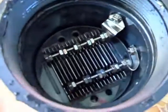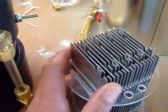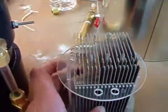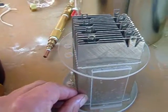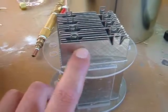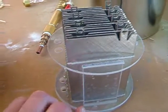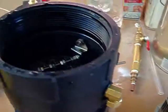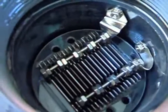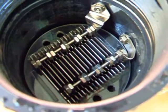This is what's inside. It's a 17-plate configuration with neutrals in between the positive and negative. The plates are treated for high performance — it's a two-step process on 304 stainless steel. You can see in the reflection they've had a treatment done. Complete stainless steel construction means you won't have any corrosion.